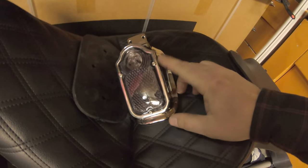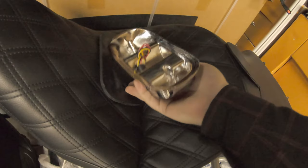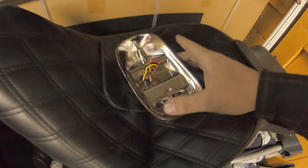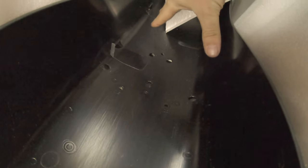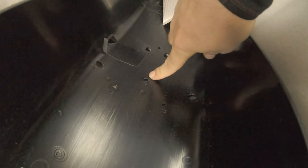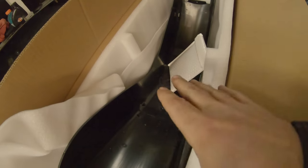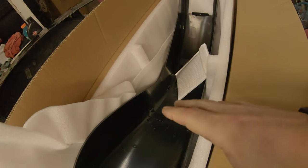All right, so we've hit a hiccup — we're calling it quits for the night. Our fancy new tombstone here from Lowbrow: not a huge deal-breaker, but our mounting holes are a little bit taller than how the fender is pre-drilled. Not the end of the world, but we'd have to drill another hole a little bit higher to make it all fit, which is doable. But the curves are a little off too, so we might look at getting our hands on an OE Deluxe taillight setup.